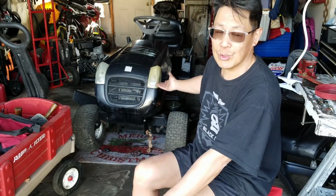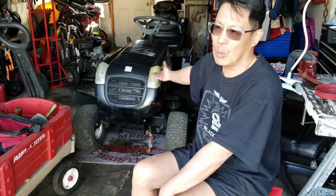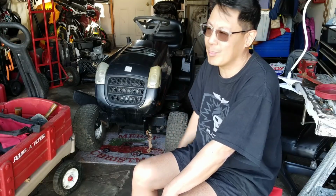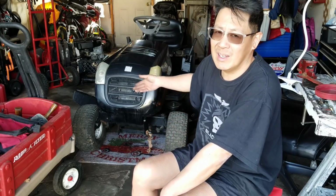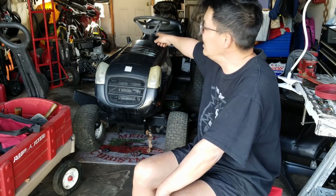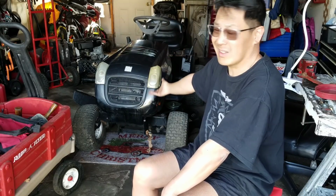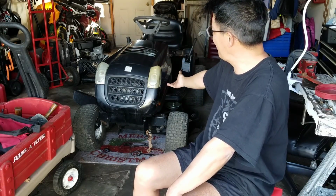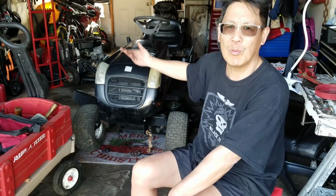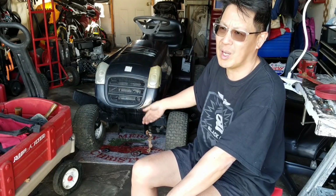So, this Murray Select, the engine now has only 75 PSI in compression, and it won't start up anymore. It'll start up for a hot second, and then it'll stop. It just won't maintain running. So I've got that other 13 that I took off of mower number 2 from Mondo. That's an identical engine. This is a 13.5 and that's a 13. So, direct swap, hopefully.